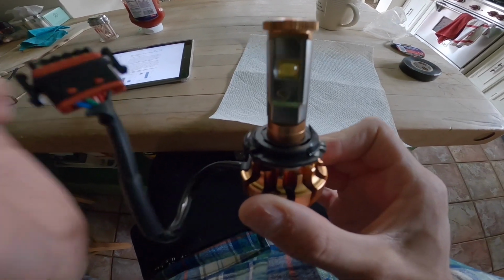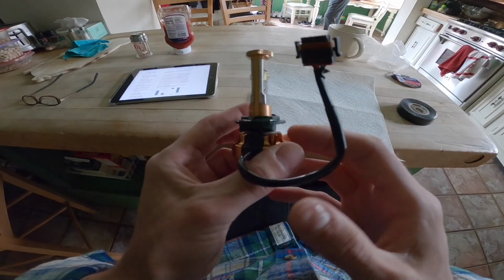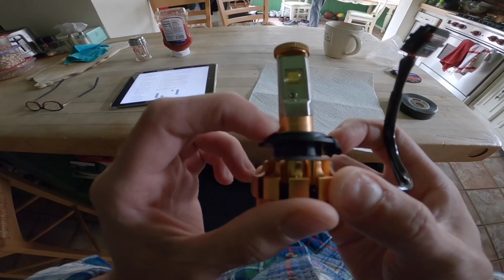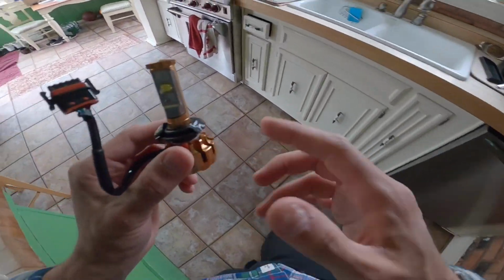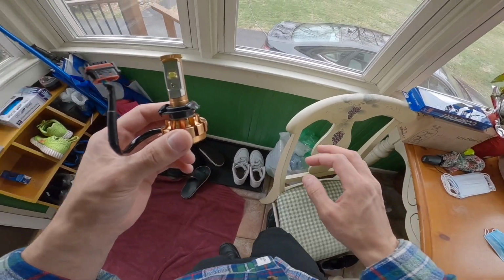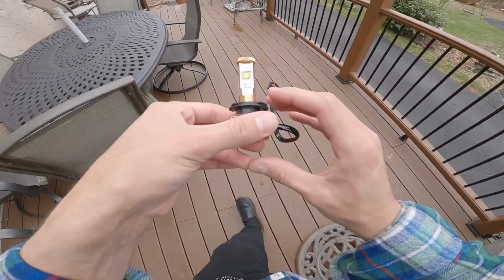So what we have here is the electrical tape shim I made. Yeah, so it looks like we're gonna need quite a bit more tape. So let's get started. Okay, so here we are. This is what we got. On the top side, this side, we probably did four layers of tape the first time, and to get the result we had. Now we did roughly 5. This side, the bottom side, we had 8, and we did 12 on the bottom side.